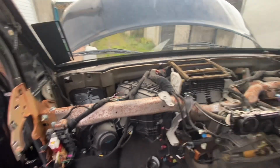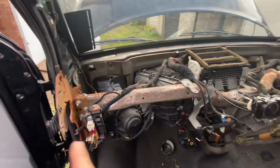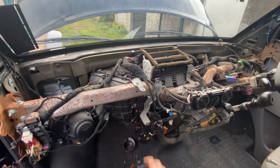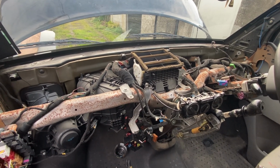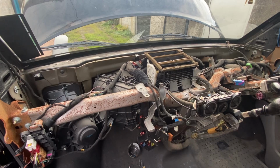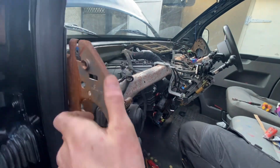It was relatively simple. I just removed the center panels, the glove box, and then left and right far panels, and then worked my way along doing the bottom panels. I'll link a video in the description showing how to remove those panels, and then the dashboard itself. One point to note, if you're struggling to get the dashboard out, it clips onto these 2 points, so you just need to lift them off to be able to lift up the sides.